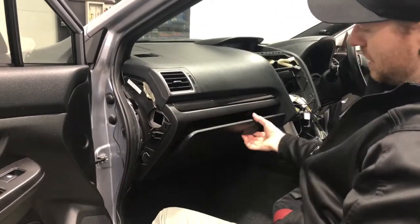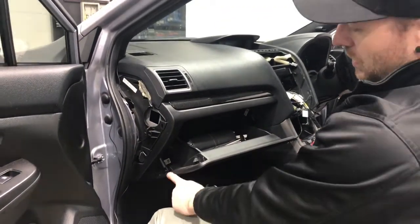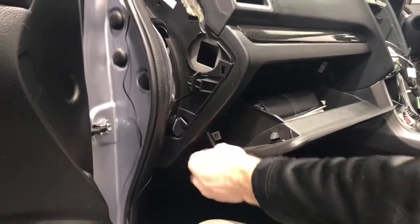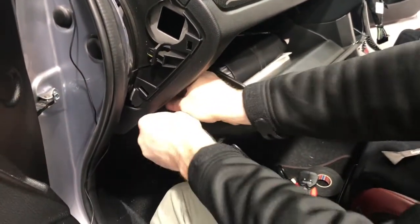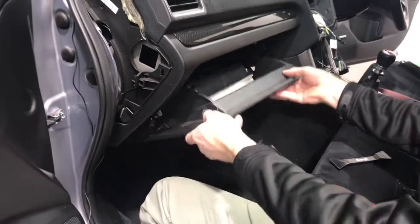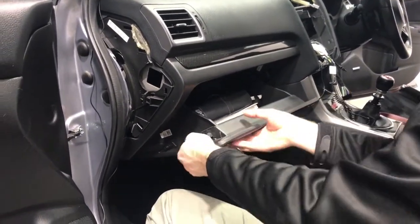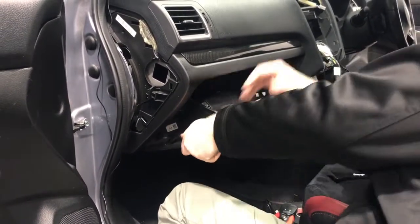The next way to get the cable across is actually to pull the glove box out, because it's not even that hard to do. On the left-hand side, as you open it, there's a little section here that you're gonna pinch together. So you're gonna pinch that together and pop this section off. Sorry. There you go. It's actually pinched it, and you can see that's come loose now. So that is just the thing that slows the actual glove box down as it opens. And then all you gotta do is pull the left upwards towards yourself and the right, and you actually hear it pop. Okay.